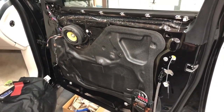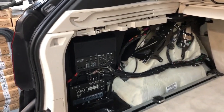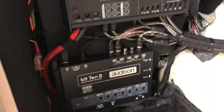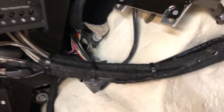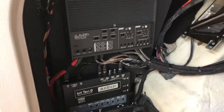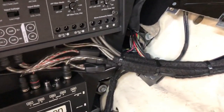Back at the rear of the car, the electrical installation is now complete. The amplifier and processor are very neatly installed — everything has been fully Tesa-taped and held in place with cable ties. The loom follows the factory loom of the car, which we always try to do. We don't want wires running everywhere in case anyone else needs to work on the car. We want all our work to be to a factory standard — and looking at it, it most definitely is.